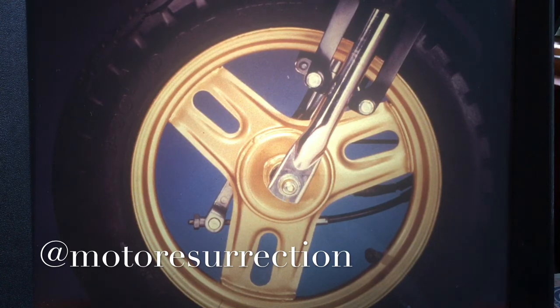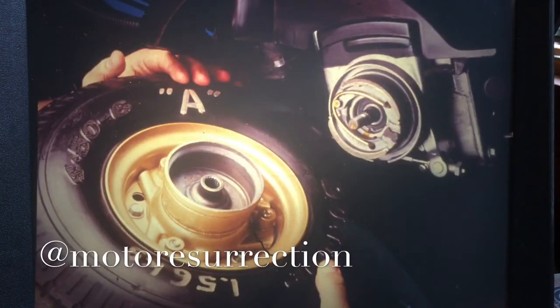Be sure to check your shop manual for procedures and torque specifications when working on this unit. And check the new specification for parking brake free play. It's now 10 to 15 millimeters. The rear wheels are a split rim design with a bolt-on brake drum. Easy to work on and just another refinement for this model.